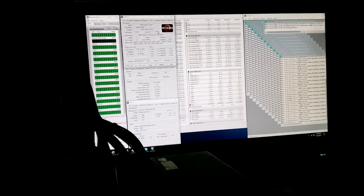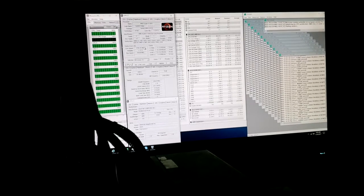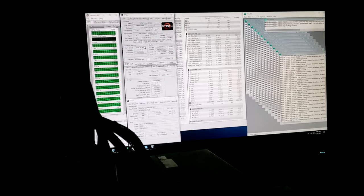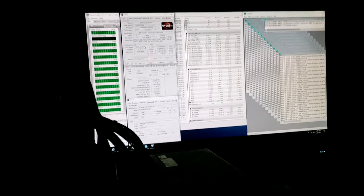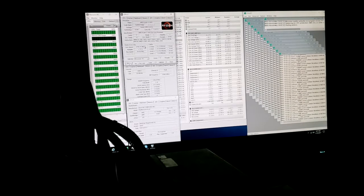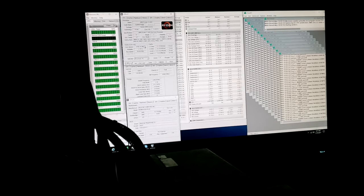This chip is worth overclocking. It's doing 3750MHz — that's actually about 150 megahertz over its possible turbo speed. This is the chip for the overclocker; the 1600x is the chip for the average Joe who just wants to plug in and play. This is what you should be looking for if you're interested in the six-core. That said, silicon isn't equal — I don't think this is a stellar sample. In an X370 board that won't melt its VRM, I'd be hard-pressed to get 3.9GHz at 1.40V at the socket.